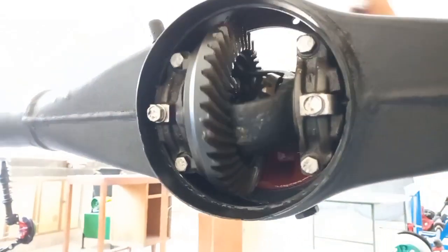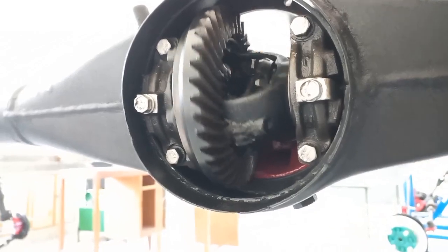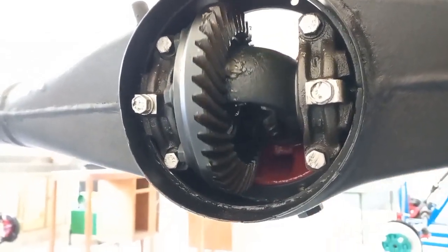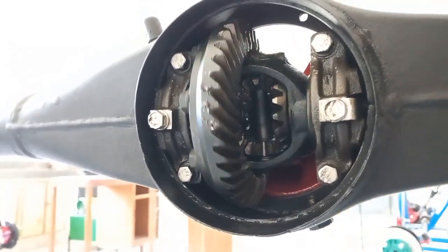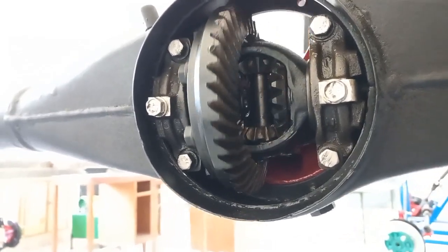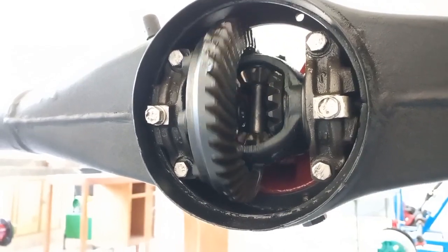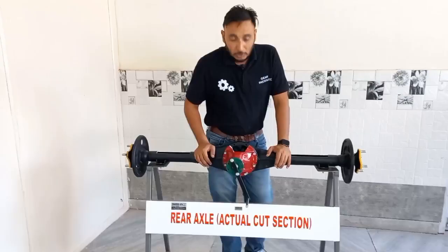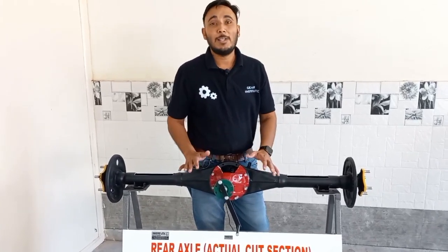This is what happens when we turn. Now I leave it — turn it and see. This gear has stopped. Can you see it? I hope this is clear. You are going straight on the road; as I turn it, you can see this gear inside starts running. So you can understand the differential working. This differential works like this. I hope this concept is clear.